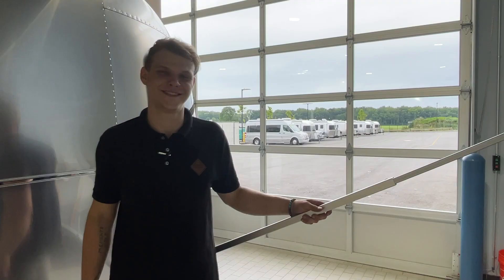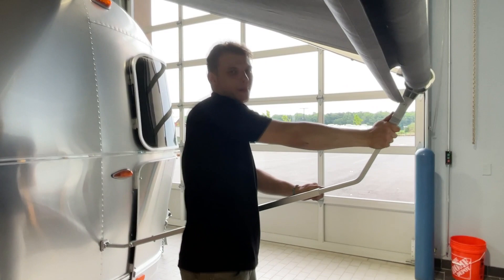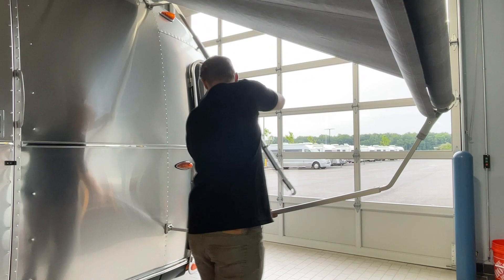When it's time to put away your awning, repeat these same steps in reverse. Start with the arms — pull the release and allow the arm to come all the way back in. Now come up to the release on your rafter arm, pull it, reducing the tension, then remove it from the barrel and stow it right back on the retaining clip on the arm where it began.